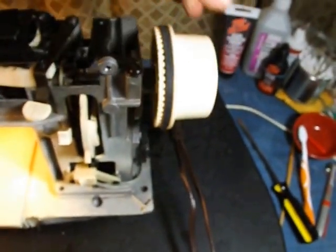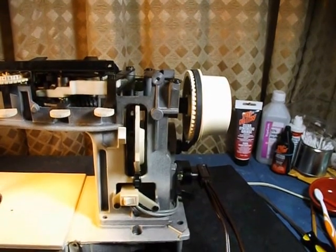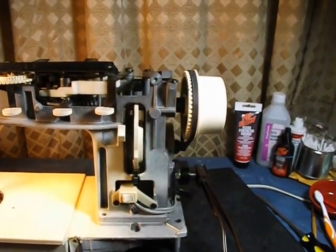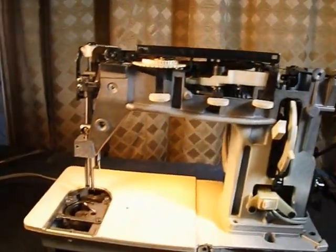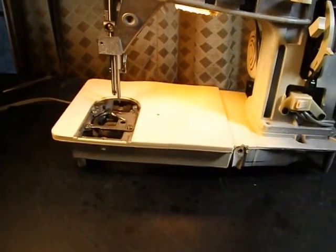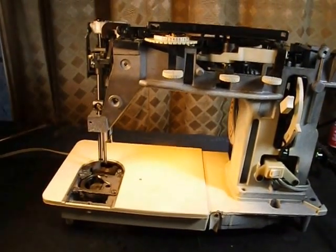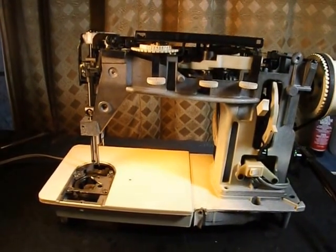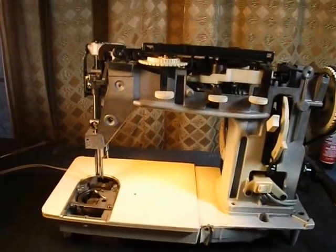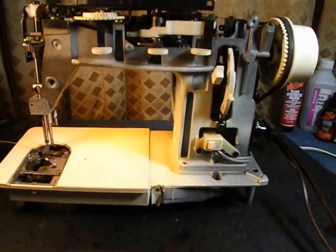These belts last a long time. I took off the original belts, but really they looked fine — the machine wasn't used that much and they weren't worn down. But since they were maybe 40 years old, I decided to change them. I got the 2 belts for $15, and it took about 5 minutes to put them on. Everything else was in real good shape. The timing to the needle and the bobbin hook was off by about a 64th of an inch, so I just fidgeted with it a little. The needle bar timing was just barely set off a hair's width, but since I had everything opened up I figured I'd set it all up properly.